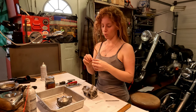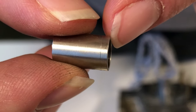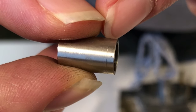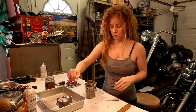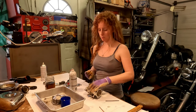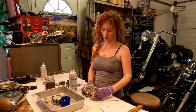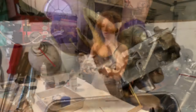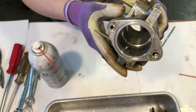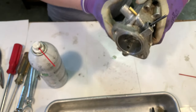The instructions say there's one end on the new bushings that's the starting end, indicated by a line on the bushing — that's the end going in first. To drift the old bushings out, I'm pushing them out the same way they went in. I've got this allen head bolt that's the perfect size — it fits in over those bushings — and I also cut the ends off an allen key to use as a drift, just holding it in my hand so my hand absorbs the impact.